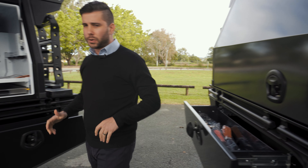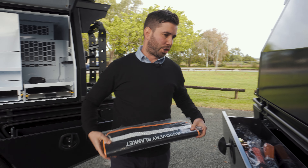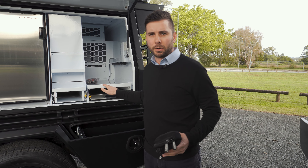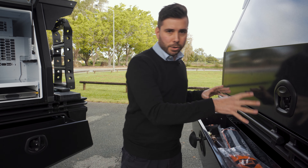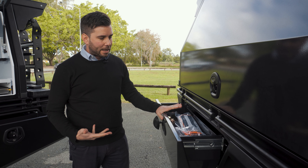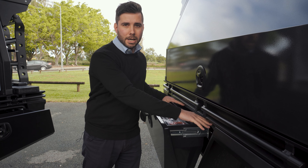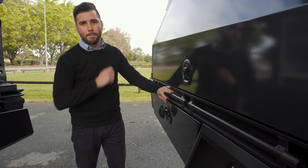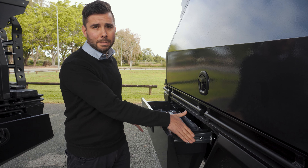A lot of people ask us about our toolboxes because they are a little bit different to a lot of other products on the market. When we designed our product it was from a blank piece of paper — we looked at how people have been doing things for a long time and felt we could do a little better. There are a few benefits to this system: everything is within its own shell — it's a bucket that sits within its own shell — so you can load things up and when you pull the door open everything's not going to fall out. All the moving parts sit behind the rubber seal, which means when you're driving everything is pretty much airtight — dustproof and waterproof. We don't have hinges sitting right behind the rear tires flicking mud and sand, which over time causes degradation. With this system, everything's behind the seal, keeping it clean and working for years to come.